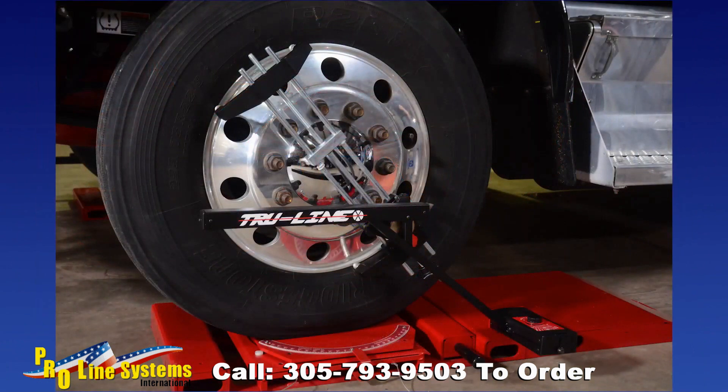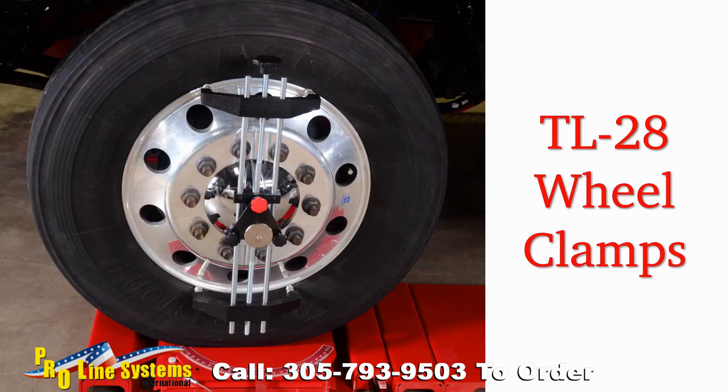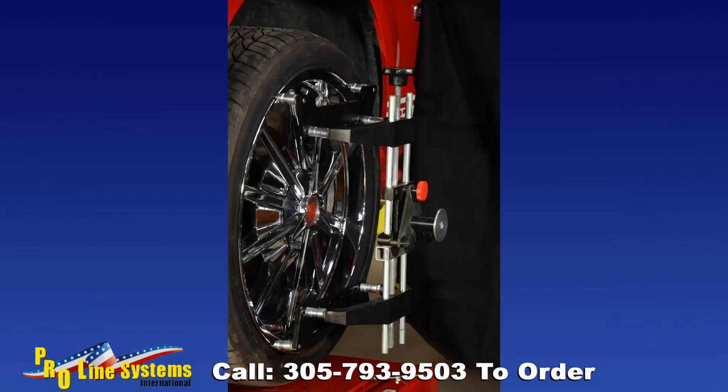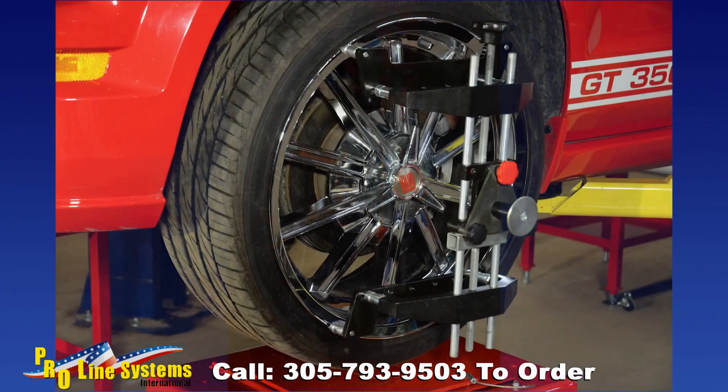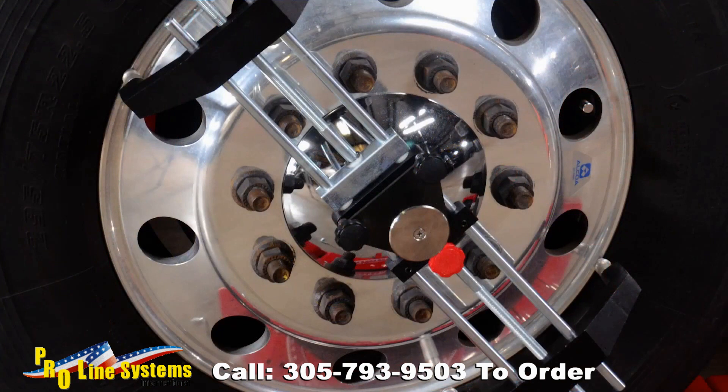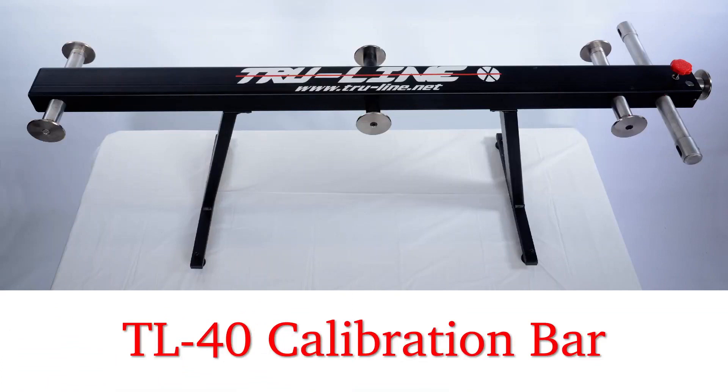The components of the TL-12 system are: the TL-28 wheel clamps, which easily mount on the inside or outside of rims from 14 to 20 inches in diameter. An optional extension kit can be added to reduce or extend the diameter by six inches. Aluminum feet minimize possible damage to expensive rims. There are run-out adjustment knobs and a mounting disc. The wheel clamps are first mounted on the wheels without gauges attached in case the clamp is accidentally dropped. The TL-40 calibration bar stores all the gauges, allowing a technician to verify calibration in seconds before each alignment.